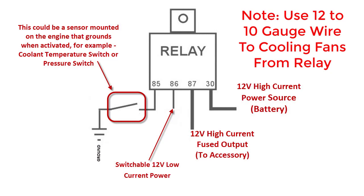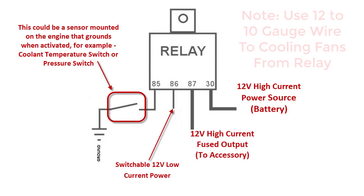As a matter of fact, even factory wiring diagrams are set up this way for the relay box. If you ever open up a power junction box, the relay is still working but the device isn't because the fuse is blown — they put the fuse in between the two. Which then comes down to an important decision you've got to make as far as getting your components correct.